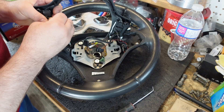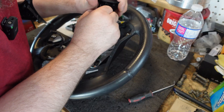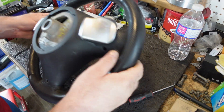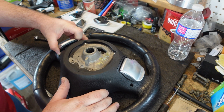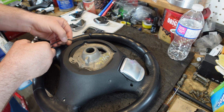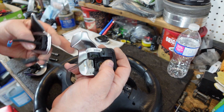Take the center trim, lift it up, and you'll see what's required to remove them from the trim itself. There's probably a proper name for it but I'll just call it the V-brace. Pull the connectors for each paddle out of the V-brace and then slowly pick them out from the back of the steering wheel. When you pick it out don't apply too much pressure — it's really easy to snap or rip the connectors off and that would be a bigger headache down the road.